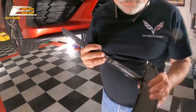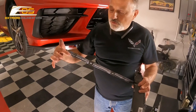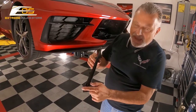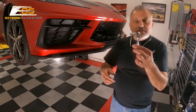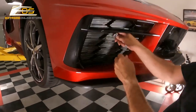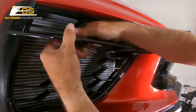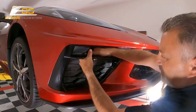You can see I'm going to show you here on the camera where they're at. When we take the other one off, we'll take the clips that are on the original piece and transfer them over to the new one, put them back in. You can see there are just little tabs here that actually fit right in. I'm going to take a small ratchet — it's a little seven millimeter — and reach up in here just like so and undo it. It takes a little finesse sometimes.